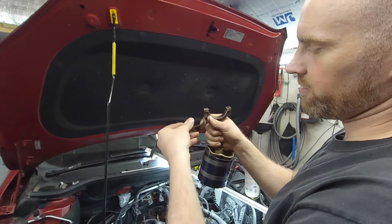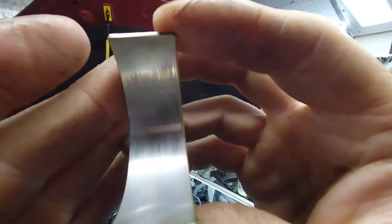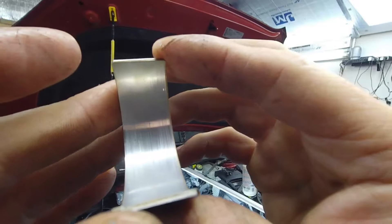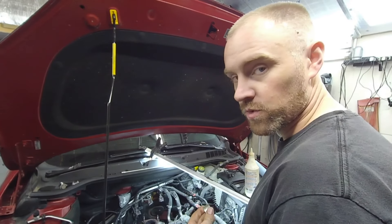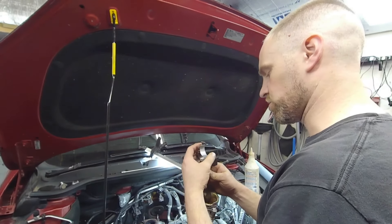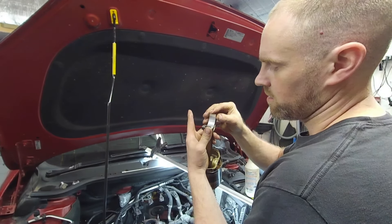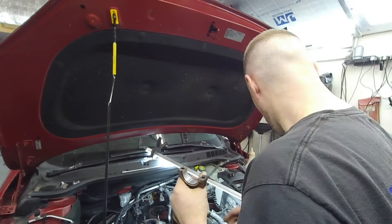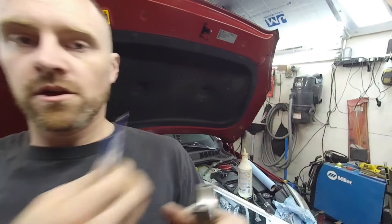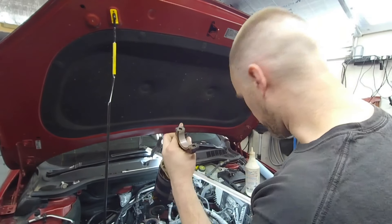You have to line up the tang. I still have to wipe this off — it's got oil on it. You can see the bearing condition; there are a few lines in it, but it's not completely shot, so it's definitely a reusable bearing. You want to reuse the bearings because they've been worked with these rods — make sure you keep them in the same exact location. Line the tang up with the slot, push it down, and work it back and forth to make sure it's seated properly. Then apply a little assembly grease on the bearing surface — it doesn't take a whole lot, just enough to coat the surface.